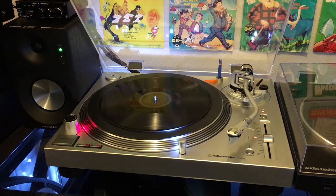Now, as you know, I'm a proponent for playing 78s with a micro groove stylus, if that's what you have, on the suitcase players. I really don't think it's going to do any damage to the cartridge, the stylus, or the record itself. After all, shellac records were designed to withstand sometimes ounces worth of downforce. A suitcase player is going to put about five, six grams down, so I really don't see a diamond having that much trouble. It may wear down faster, but it's not going to really damage it.